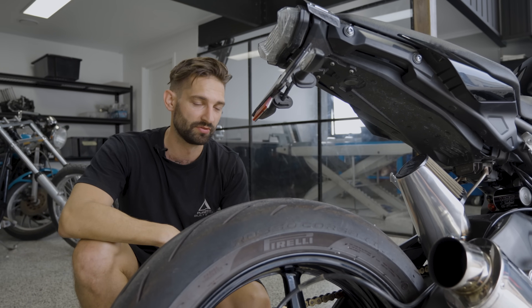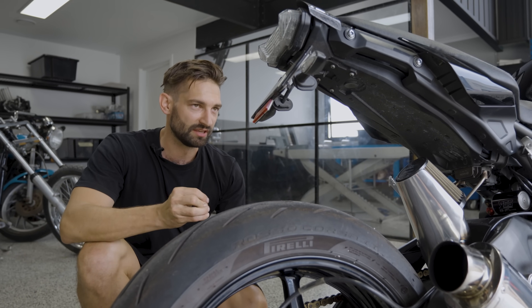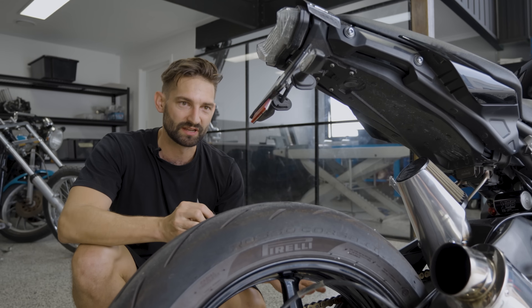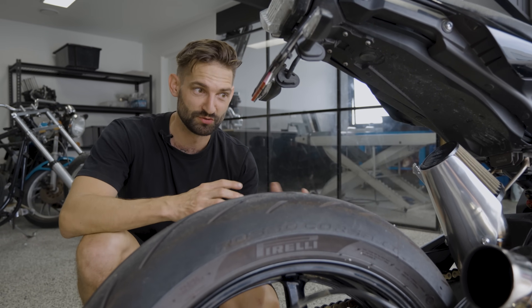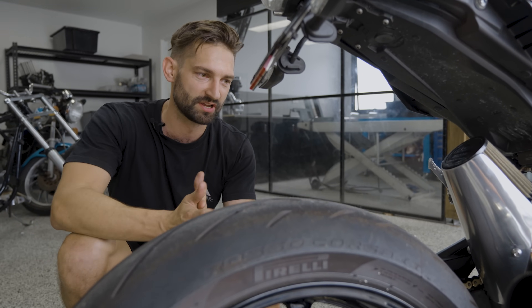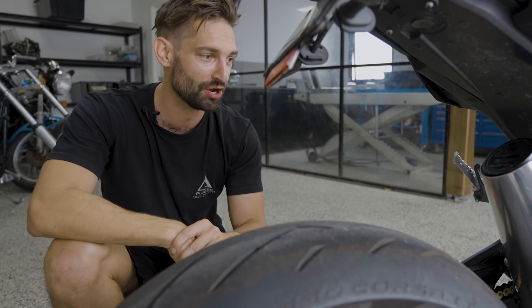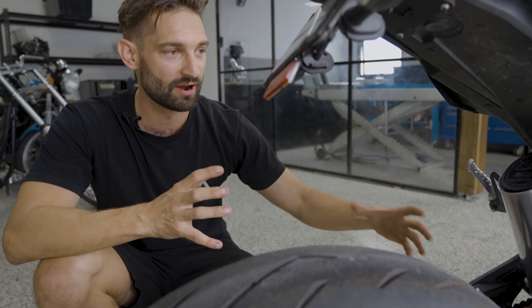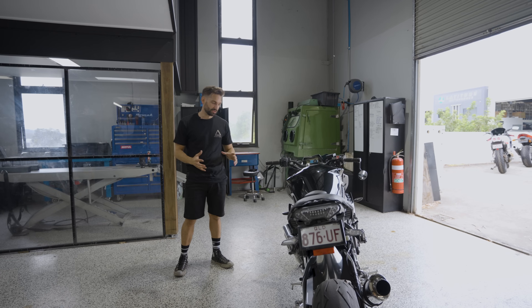This was partly a style piece but also serves a really functional purpose. The standard intake tucked underneath the chain was getting stuff flicked all over it, which wasn't ideal. We've moved it well out of the way so it's getting nice cool air off the back of the bike with a lot more airbox volume. I've read that roughly ten times your bike's capacity is what you want in your airbox — the bigger the airbox the better the engine performs. Having a big pipe and a large pod filter has definitely helped airflow getting into the turbo.